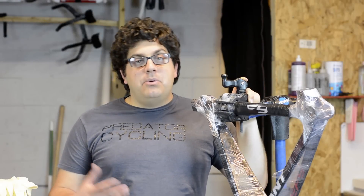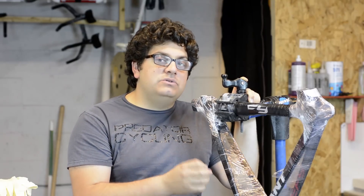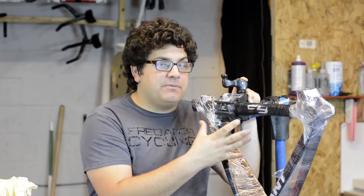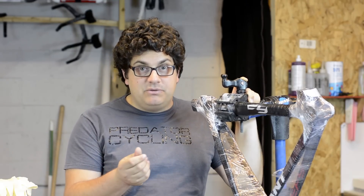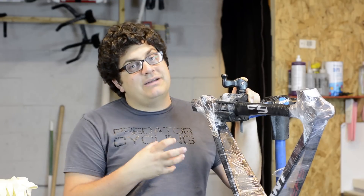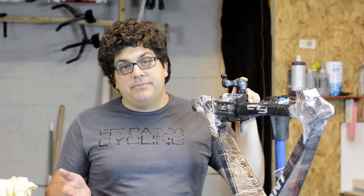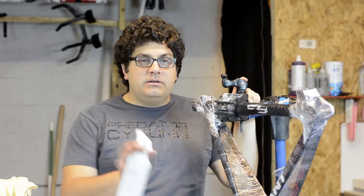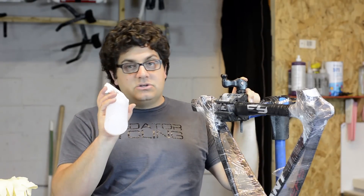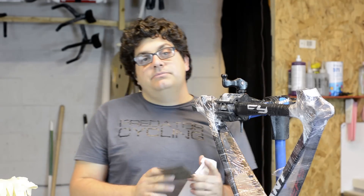You're now ready to start sanding. The point of sanding is to remove the clear coat, the paint finish, and get down to the carbon. We're also trying to remove those broken fragments of carbon coming out from the repair area. We're going to start with 120-grit sandpaper — that's the roughest — to get down to the base carbon, then use 220 for the fine detail, and come back with 120 to ensure a good bonding area. We'll use wet-dry 120 sandpaper with a spray bottle of water, spray down the repair area, and sand it down.